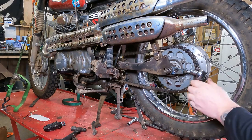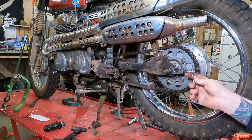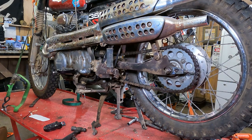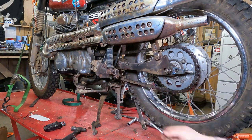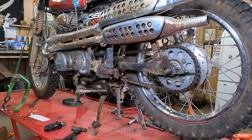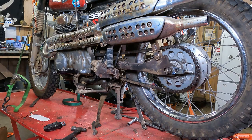We're actually only going to go a little bit tighter than that. To help maintain our alignment, you can use a wrench and do it evenly — start with the wrench at six o'clock, going to 12 o'clock. So one half turn here, one half turn on the other side. Now we'll check our tension. That's sitting pretty solid — pretty good. We got a wee little bit of sag there, about five-eighths of an inch, maybe half an inch or so, and that's set at ride height. From there, we can torque down our rear axle, put our cotter pin in, and then lock these jam nuts to hold the axle adjusters in place.